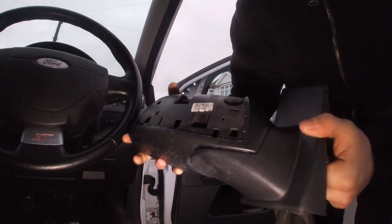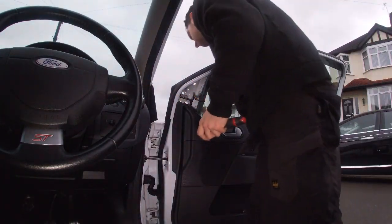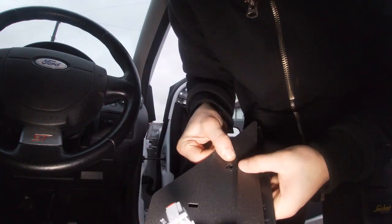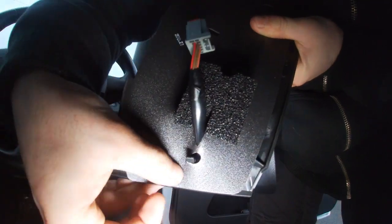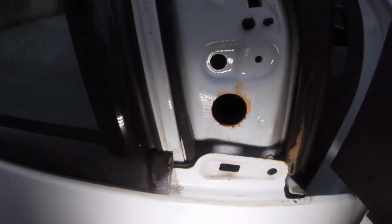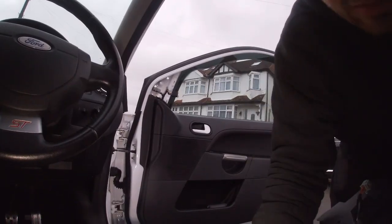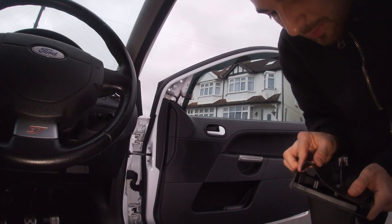That's the old mirror off now — just remember to move the little foam part that comes off with it, place it to one side as we won't be needing that anymore. You'll see a new sponge cover that goes over the bolt holes, and then two little tabs down here. All you want to do is line those two tabs up with the two holes there. The door's a bit rusty on both sides so I'll have to get that addressed, but fitting the mirror is pretty straightforward.